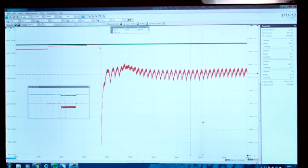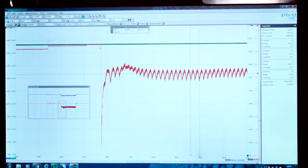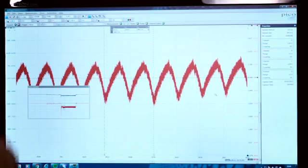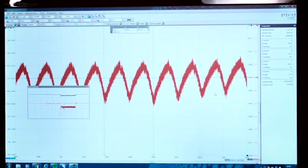We take two events — it's a four-stroke engine, so any two compression events is sufficient. The more accurately you place those cursors, the more accurate the result. The calculation gives us 245.78 RPM — absolutely on the money. So what have we proved? In several ways — voltage drop, current draw, and rotation speed, all assessed against the ampere-hour rating of the battery — they all form that magic triangular performance which proves the circuit and the consumer are of correct specification.